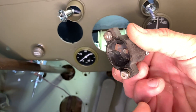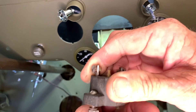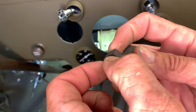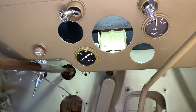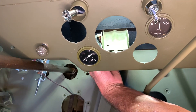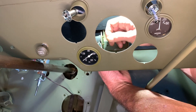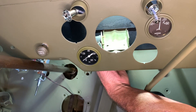The circuit breakers attach with two small screws, lock washers, and nuts. We'll remove the nut and lock washer, noting these little screws and nuts don't do well with nimble fingers. The 10-amp one goes on the ear near the steering column on the driver side, because the wire from the fuel gauge is short and has to reach that side. The holes are set at a 45-degree angle, so you hold the screws in place, slip on the lock washer, then install the nut.